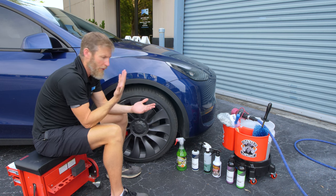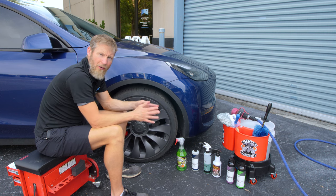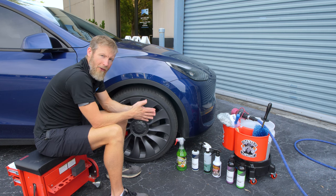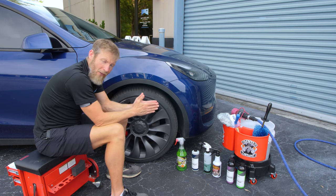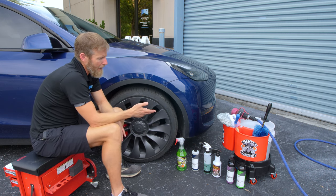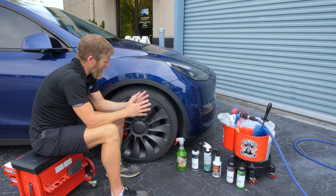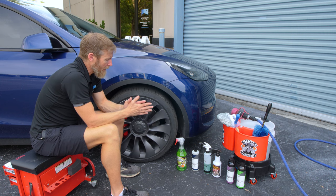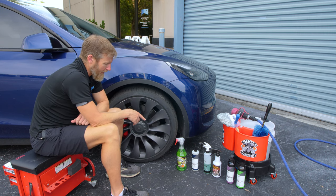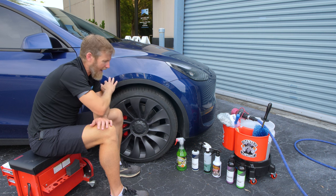So as far as contaminants and dirt go, obviously your wheels are the first thing that touches the ground. That's where a ton of dust and dirt is going to be stirred up wherever you go, especially on dirtier roads. Tar is going to get spit up on there sometimes. But the biggest contaminant you really have to worry about is brake dust — you have two pieces of steel hitting each other, creating little tiny pieces of brake dust flying off all the time. If you don't have Tuga on hand and you have Reset and Iron X, you can get things cleaned up pretty easily. But the Tuga is going to do the job of both the Iron X and the Reset, dissolving the brake dust and the embedded pieces of steel stuck to the surface, and also loosening the dirt so everything just comes right off.